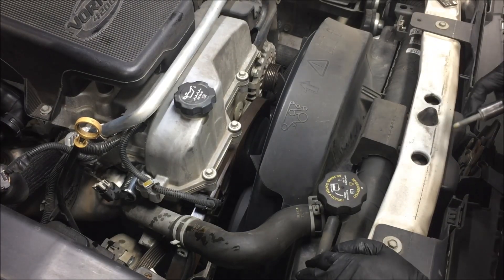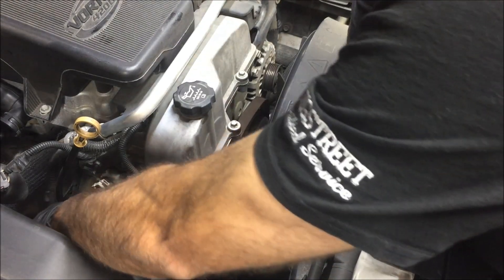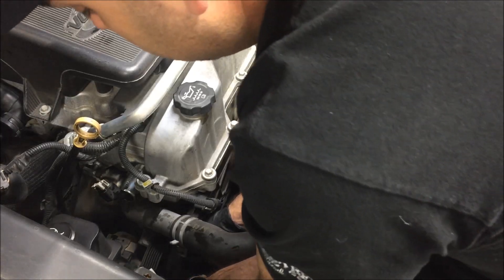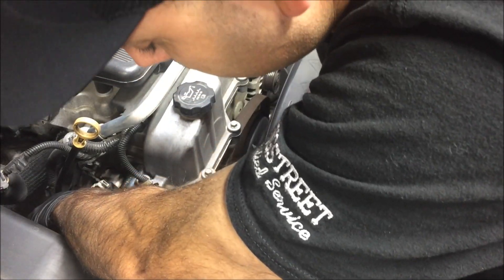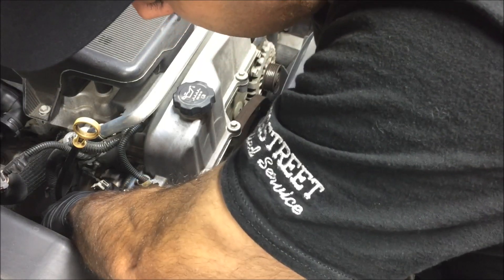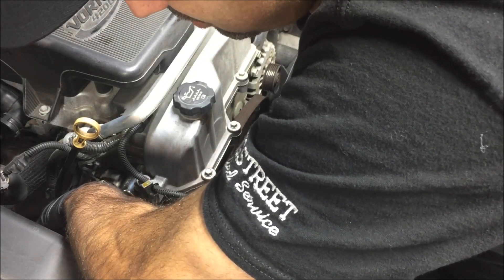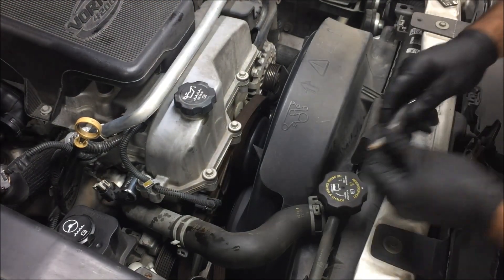After that it's time to put the power steering pump back on. What I like to do is put my bolt into the socket, hold it in my hand, and lift the pump up — put the top bolt in first. You don't want to tighten any of these down until you have them all started. Get each one in as far as you can and then move to the next one.